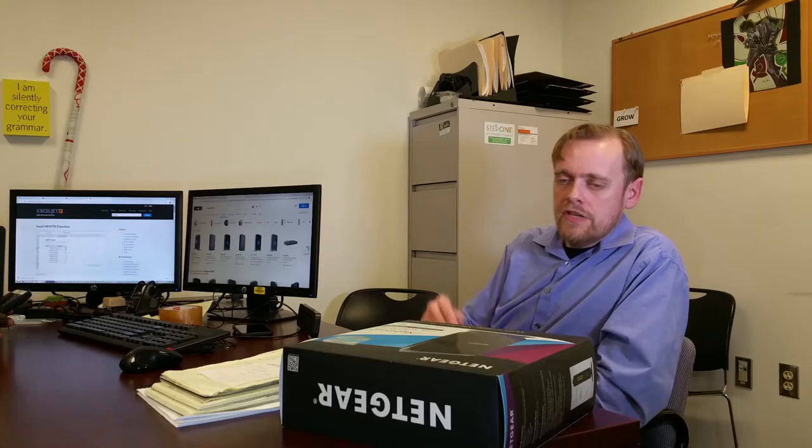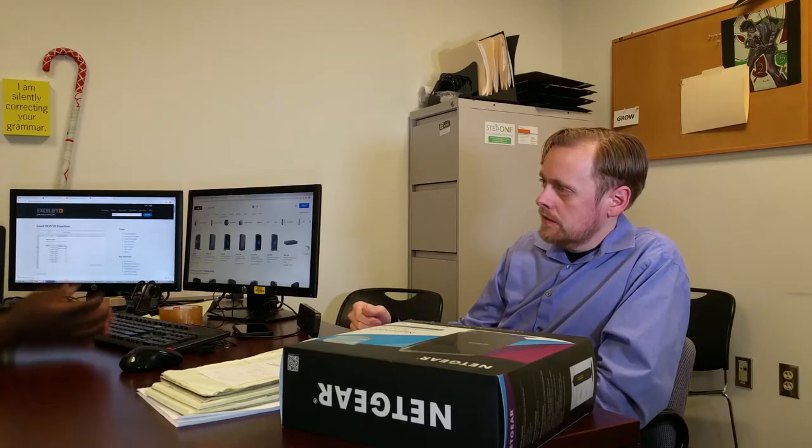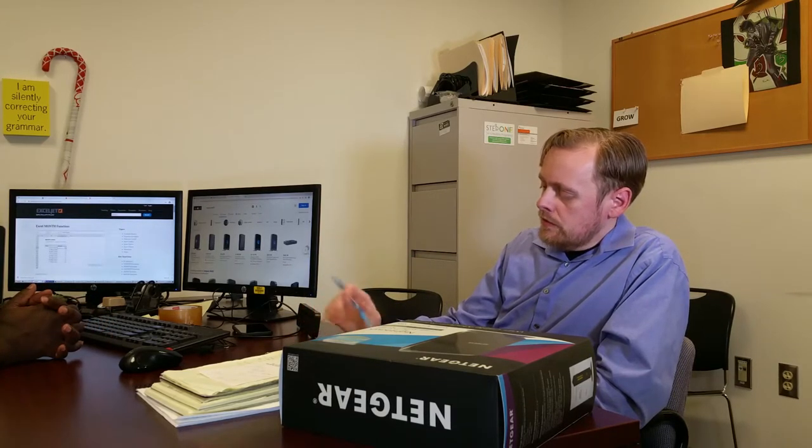It's a little bit more geeky, but once you can get into the configuration menu of this device, it becomes easier and you start to understand what you're looking at. So you've been running that Netgear N600 for 2.5, maybe 3 years. I can put that up later and throw some stuff up on the screen. But the point is, I bet you the modem in that thing's working fine and the Wi-Fi's going out. That makes sense, because when I plug in the Ethernet cord it seems like it works then.